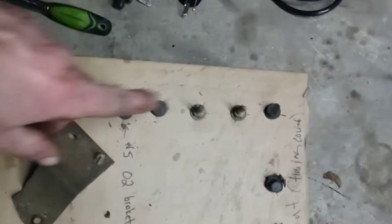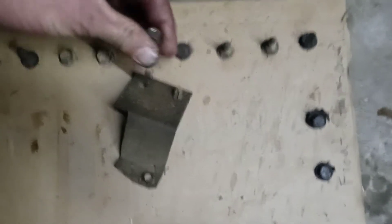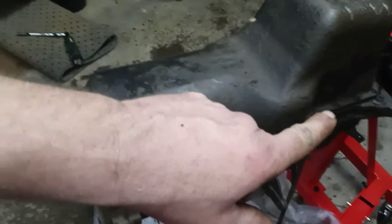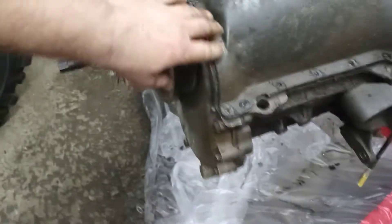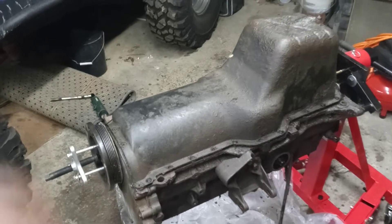Take all your bolts out. I drew a cardboard diagram showing front of the Jeep, back of the Jeep, passenger side, driver side. Some of these bolts are different — the fifth one back on the driver's side holds the bracket for the O2 sensor and it's a nut on top of a stud. I thought the whole stud was coming out when I was undoing the nut. It fell off and went bouncing around and I had to go hunt it down — first step of the video was a disaster. The oil pan is broken free now. It was easier to lift from the rear, bouncing it up. Up front when you put it back together you've got to put a ton of silicone underneath — it's a wide gap, probably that wide.